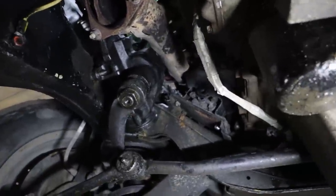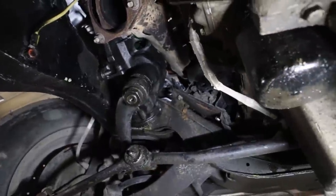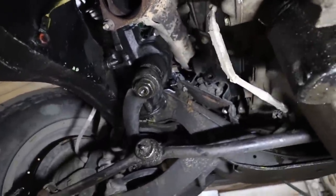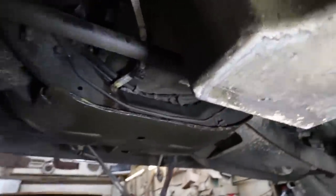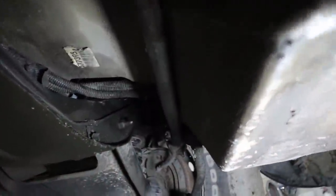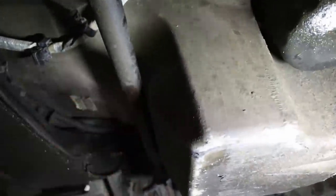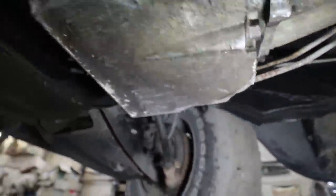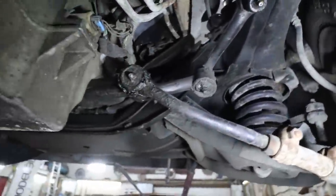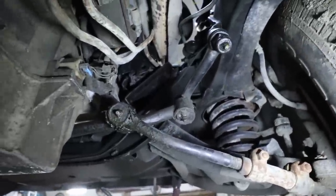So I don't think it'd be the end of the world to raise the motor up, you know, a half inch, an inch. Try to get this lined up, get a little bit of breathing clearance. You can fit a sliver of paper through here. Wow, a little more than that. So the clearance is like, eh. I know I did this on my wife's truck, but I guess just being that it was a Dodge or something, there's something totally different about it.